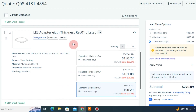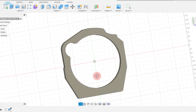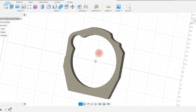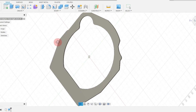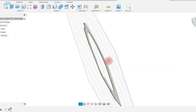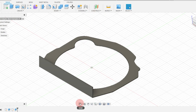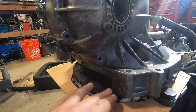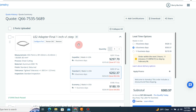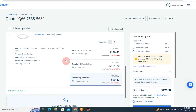Made in USA and $270 versus over $600 — that's not a bad deal. I'll go back into CAD and finish up the design: one inch thick part, plus an eighth-inch-thick part where I changed a little bit of geometry down at the bottom underneath where the flywheel is exposed. My thought is once I get this, I can bend that bottom plate outwards to close that gap underneath the Subaru flywheel — kind of make it an integral gap cover. Uploading the final designs to Xometry — they make you wait 11 days, but $270 versus $600-something, I'll take it. All made in USA.